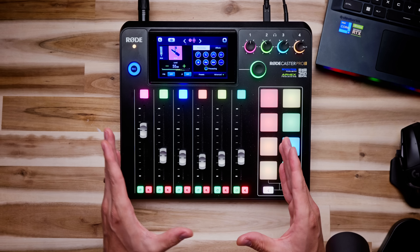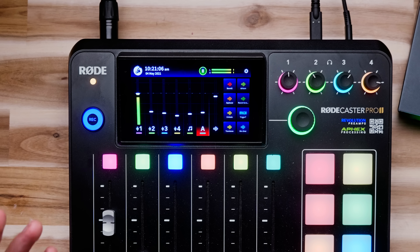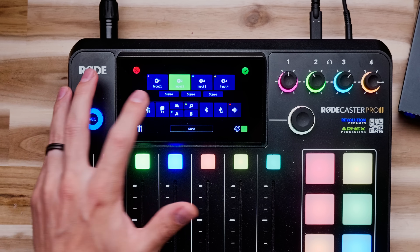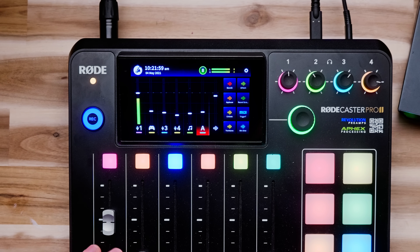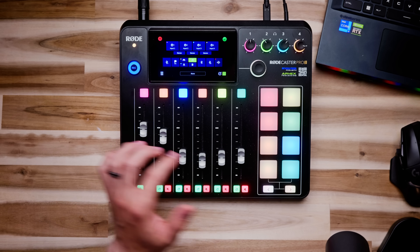Let's talk about the faders. Mixing on this device is incredibly powerful, and RODE added an update that makes it work a lot like normal gaming mixers — similar to the GoXLR. Make sure your device is updated and the feature is activated. Back on the home screen, you can see four microphone inputs on the first four faders. If I'm only using one mic, I can reassign a fader — tap the button, hit the settings icon, go to virtual inputs and outputs, select the game icon, and now that fader controls game volume. I've also set the fifth fader to control music volume, like Spotify.